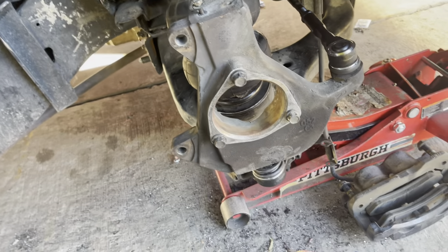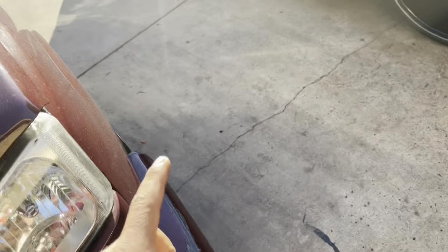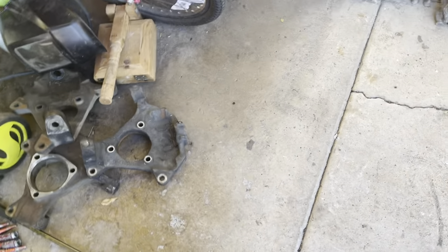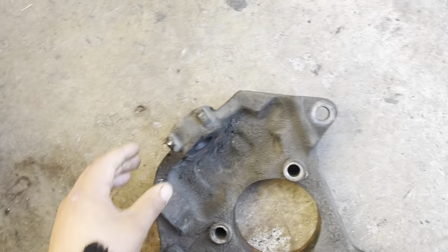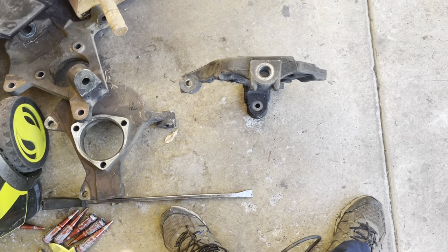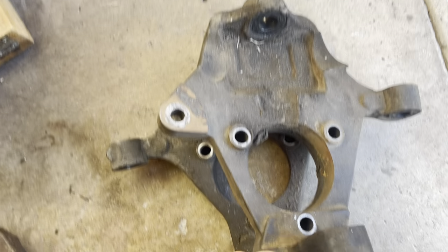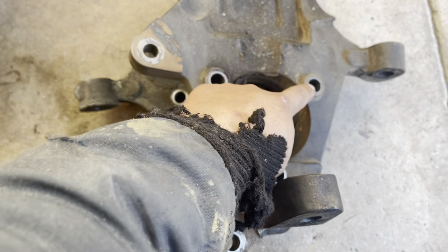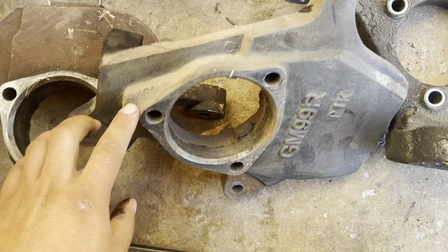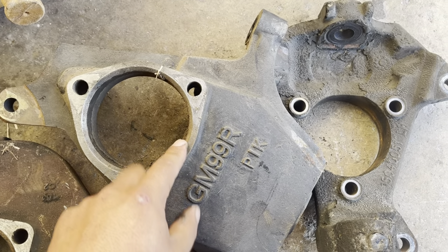I'll show you on the other side how we managed to do this. This is the first one waiting to get the parts and the second one is on this side — I don't have it torn apart yet, but I'll show you in a bit. Yesterday they gave him some spindles but they gave him two left spindles. We hauled it out — the ball joint is inside there. The other thing we found out is I've never seen two-inch lowering spindles like this — you're able to put all the nuts through the back. Usually when you have drop spindles you have two in the back and one in the front, but this brand is pretty cool, it's the first one I've seen like this.